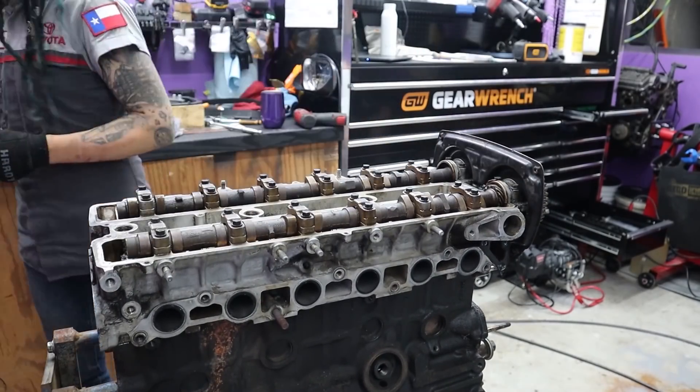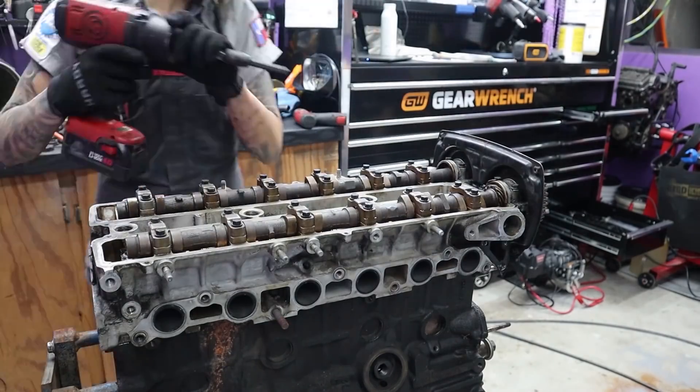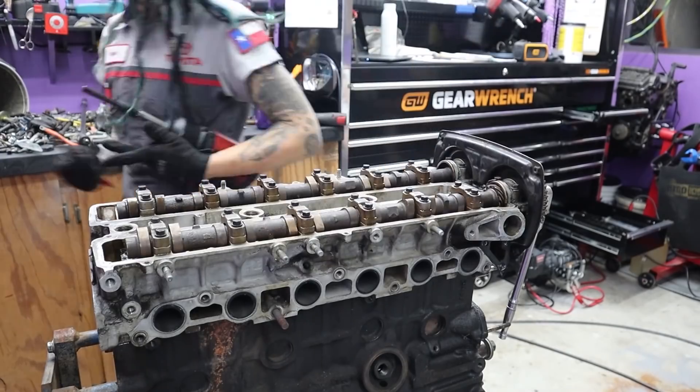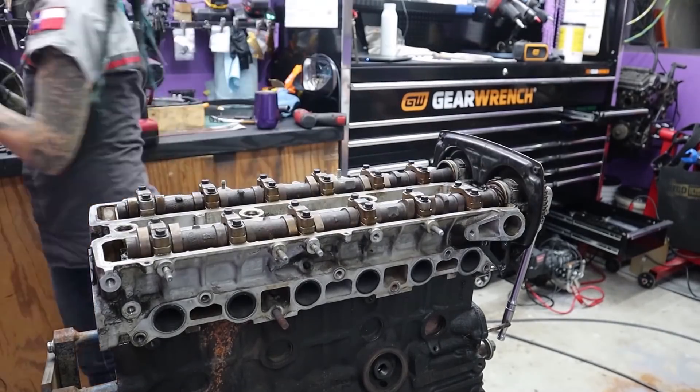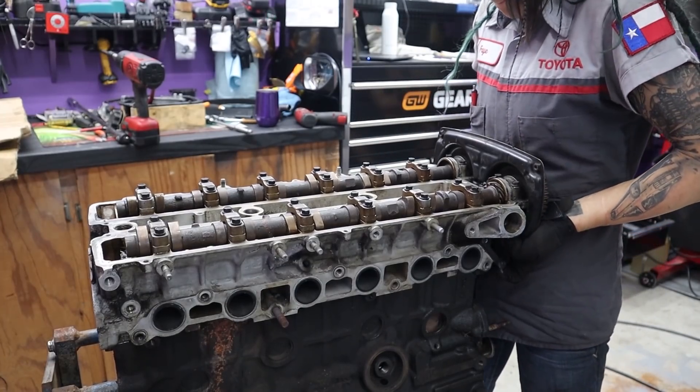With a bit of research and the shop verifying part numbers, we confirmed that the crankshaft and rods are identical between turbo and non-turbo blocks. So I immediately got to work removing oil pans and inspecting my fleet of 7M GEs to find the best donor for my donor.